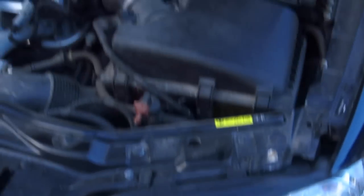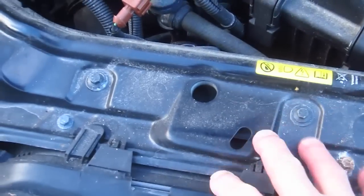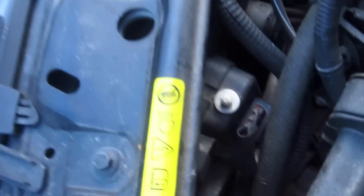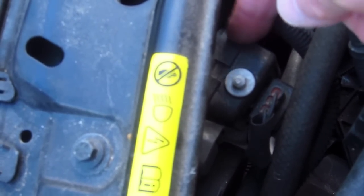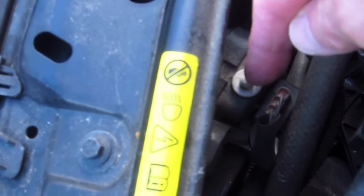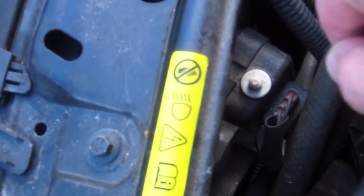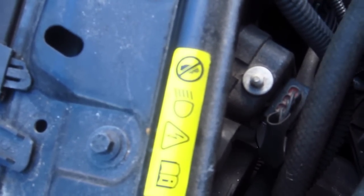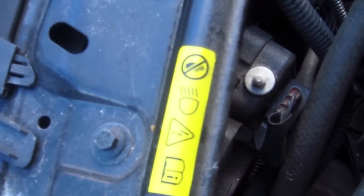Alright, back to the headlight. I've got the hood open, and if you just go right back here and look at this — see this right here? This is an assembly, and this little screw right here, it's a hex head, a quarter-inch hex head, with a big flat washer head. All you have to do is rotate that with a nut driver, and your headlights are going to go up or down depending on which way you turn it. It's really, really simple.